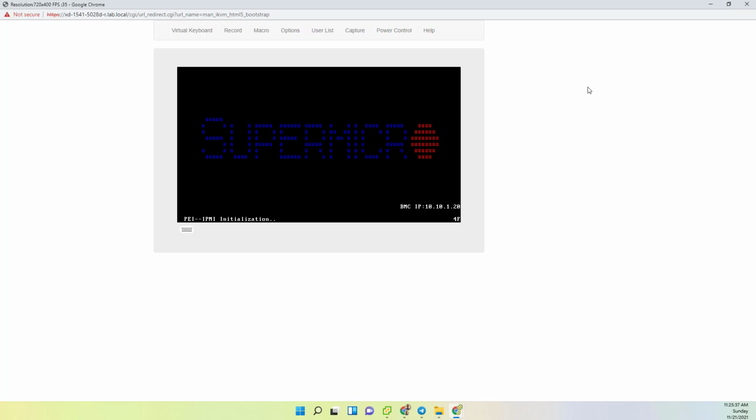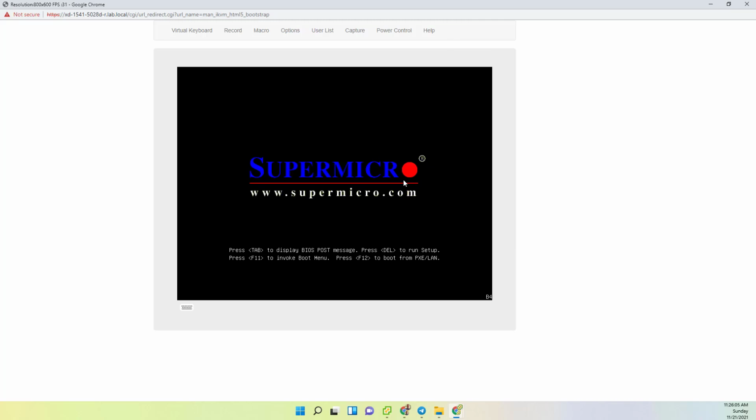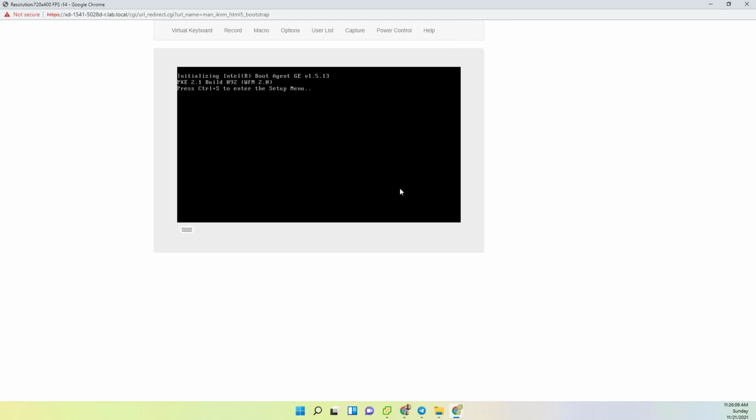So it did not save my settings. Oh well. All the more reason to have good documentation on the settings that you do have. Heck, if you have Camtasia, go ahead and record like I did before you go messing around. That way you'll have a happy BIOS upgrade experience without losing time trying to reconstruct your settings, trial and error, that kind of thing. So at this point, there's no point in resetting to factory defaults because I already know it did.